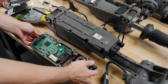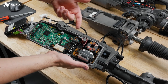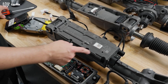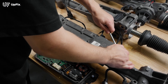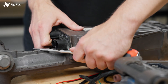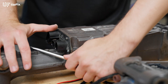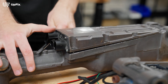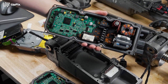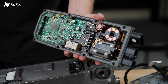The final step is to remove the power steering module from the rack. As you can see what it looks like on the other side, you don't want to put the flathead screwdriver too far inside so it doesn't damage any components. Start where the plug is — on this angle you can wedge it in and just push up against the power steering module. You'll see a little created gap and you can work your way back and forth very carefully until you start seeing it removed. And there you have it — that's the power steering rack itself, with the tabs that it connects to and the power steering module.